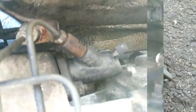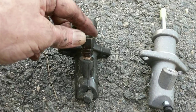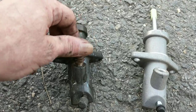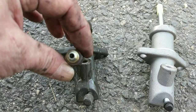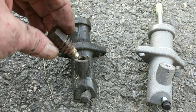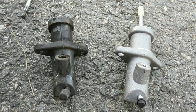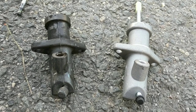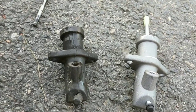I'll show you what you have to transfer over to the other slave cylinder. With it out, you can see this part screws in there and it doesn't come with a new slave cylinder. This is what BMW calls a proportioning valve, or a restricted valve. This is actually a BMW 540i 6-speed. BMW does a lot of things to their cars to make sure you don't forget that they are luxury cars — this is one of them.